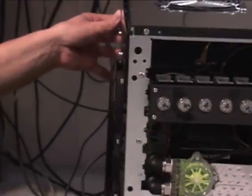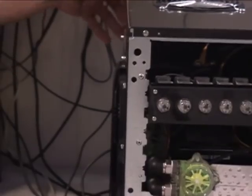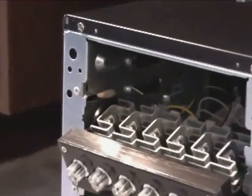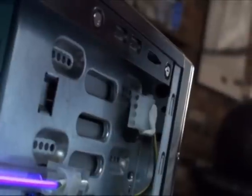It's important to build up enough of the putty so that when you close the panel, the putty will get pressed against the chassis and some of it will squeeze through the unused screw holes along the side of the drive bays. Now working through the vacant drive bay at the front, I press the putty that squeezed through so that when it's cured, it will be locked in place. Although there is little room to work, you have to ensure that the fresh putty doesn't merge with the hardened putty on the female end and that the Molex assembly is parallel to the removal of the panel.